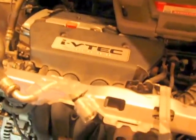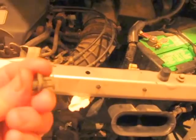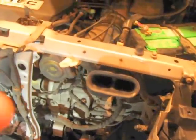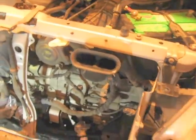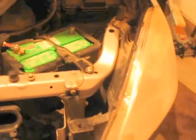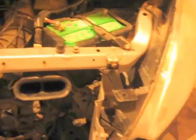That top plastic piece goes right across here, and it's held in place with a whole bunch, about 8 or so, of these little Honda push pins. And they pretty much get destroyed, especially underneath, when you go to take them out. So I just ordered like 40 of them off Amazon for $7 or something. So anyways, number one, take off your negative terminal there. Pop out all those pins on the top, and that top piece just slides right out from here.